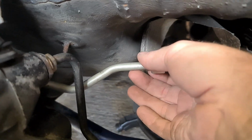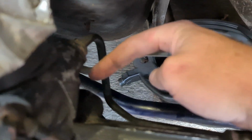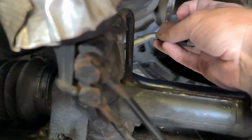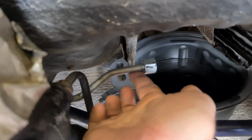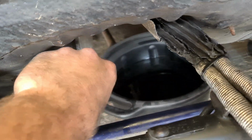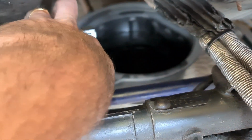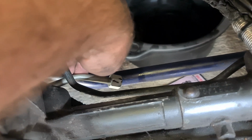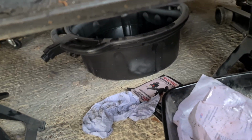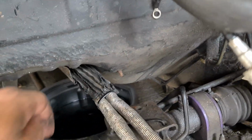So basically that should go that way and through that pipe there, and the way it currently sits with it mounted, it will sit proud. It will sit either proud like that, which is exactly where the exhaust would go, or it would angle down like that, which therefore means the other part would end up sort of angled down here and then would foul the chassis leg. So I just need it so that it's got more of an angle on.